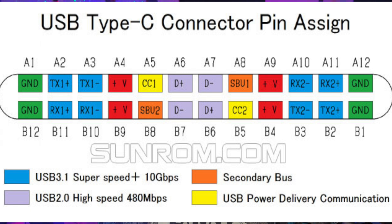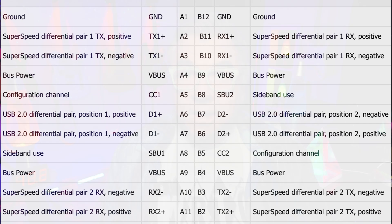Now, can a USB cable or USB port partially fail? Yup — it's not very common, but it has definitely been known to happen. USB-C connectors have 24 pins and they perform different functions. You can see how they're labeled in this picture. It's possible that stress was put on one pin and not on the others, and that may be why one pin has failed completely, or maybe it's intermittently working. Considering that we plug and unplug that USB-C cable into the ToneMaster Pro numerous times, there is a real possibility that there could be a problem with the USB port.